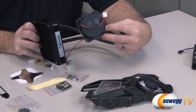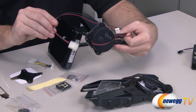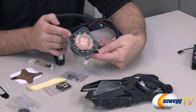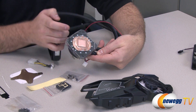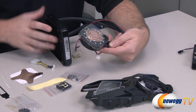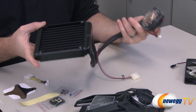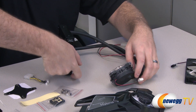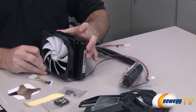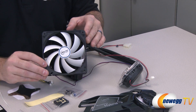Here's the water cooling unit itself — as you can see it's an enclosed water loop. There's some cabling coming off so you can plug this in and provide power to the pump. At the base they have a nice copper block, which is going to provide direct contact with the GPU. Since they're making this for a more specific GPU, they were able to fashion it so you get direct contact only on the GPU itself. Here is your actual radiator right there — pretty standard closed-loop radiator. And finally you get a 120mm fan from Arctic with white fan blades. You can attach it to either side of the radiator whether you're doing push or pull, and all the different configurations are referenced on the box as well as in the manual.